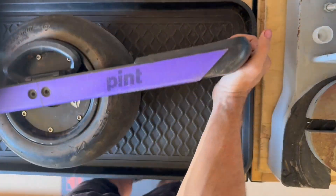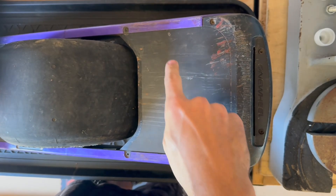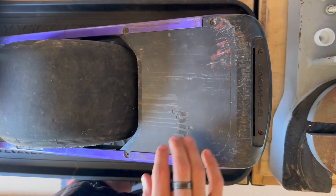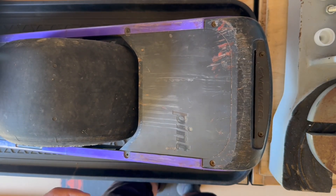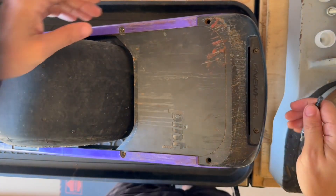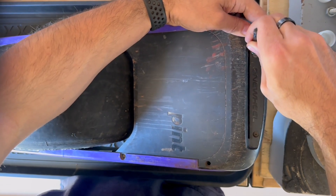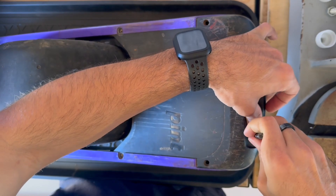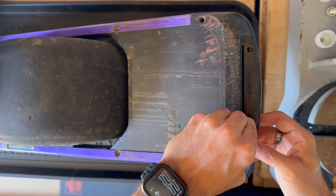Next I'm going to flip this thing upside down and take out the six TP20 screws — two in the nose, two in the other part of the bumper, and two close to the tire. The first four go through the bumper into the foot pad; the last two go straight into inserts on the bumper. Sometimes those last ones are a little stubborn when lining them back up. These two near the tire sometimes require flipping the board or angling the bit. The TP20 really helps here because the T20 usually doesn't work as well when trying to pry these out.